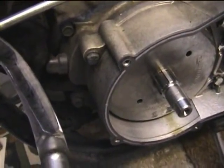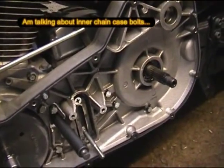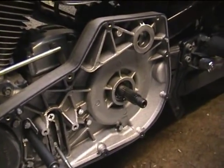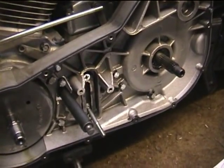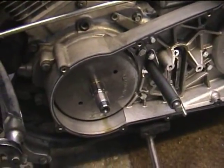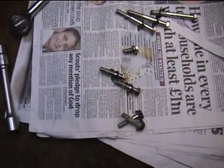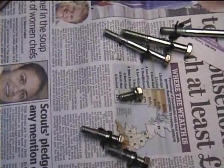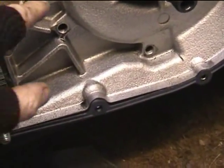I'm locking these two guys — one there and one below. These guys I'm taking them apart or just backing them off right the way across the case, because I don't want to leave the back end flopping around with a tight front end — just easing everything one by one. I'll look up the torque wrench settings later but you don't lean on these guys, you just nick them up kind of wrist tight. Taking all these out from front to back — those are the ones on the outside, the one on the stator cover, one on the mid-gear change, and the three at the back which came out of here.